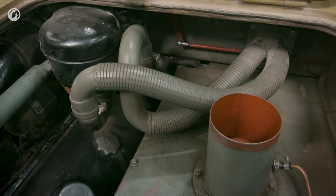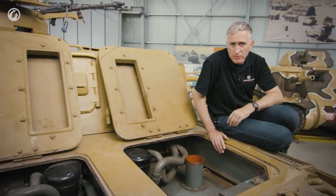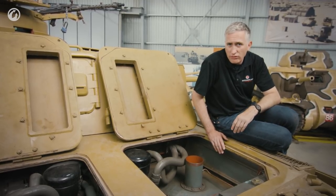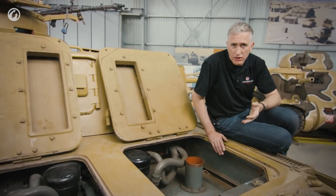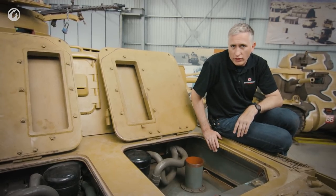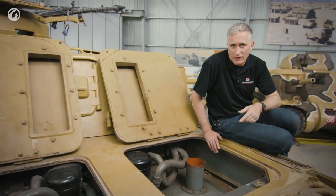Oil is a little bit further to the front. This system was such that the oil would settle to the bottom of the tank if the engine hadn't been run in a while. Thus the hand starter. The manual is fairly specific that the standard method of starting this tank — or the related StuG III — would be by the hand starter. The electric motor starter was only to be used in case of emergency, i.e. somebody is shooting at you right now. This may also partly be because of battery drain or the unreliability of the motor, but talking to the mechanics here, they always have to be careful about the oil — similar to the radial engines on aircraft, or American tanks where you had to hand-crank it before you got going.